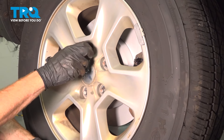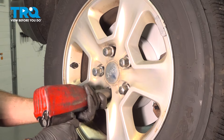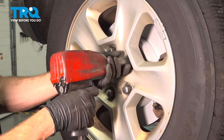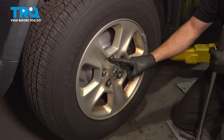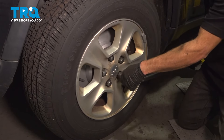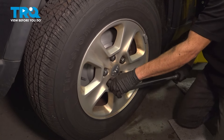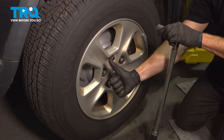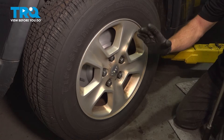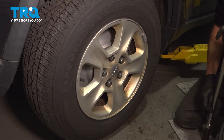Now we can reinstall our wheels. Start all five of the 22 millimeter lug nuts, bottom them out, and get the wheel safely back on the ground. With the wheel safely on the ground, torque each of the lug nuts to 115 foot-pounds in a criss-cross manner. We showed you how to install the rear brakes on one side — make your way over to the other side of the vehicle and do the exact same thing. After you've done that, pump up the brake pedal until it's nice and firm, and take your vehicle for a road test.